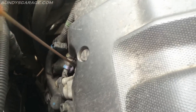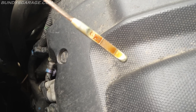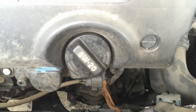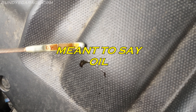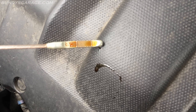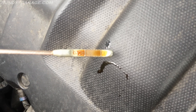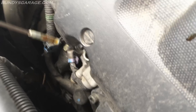Another thing you want to do when the engine is cold is check your oil. Right here I'm pulling off the dipstick — you see a crosshatch mark. The upper line is where the oil should be when it's cold; if it's below that, go ahead and add some oil. Right here on the oil fill cap you can see it says 5W20, so this engine calls for 5W20. As you can see, the level on this vehicle is just a little high, but the engine is also a little warm, so your best bet is to check the oil and coolant first thing in the morning after the engine has cooled down completely — when it's ice cold.